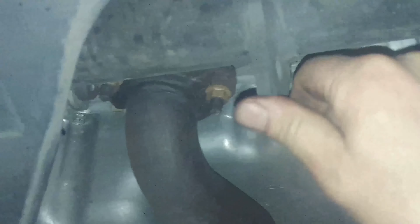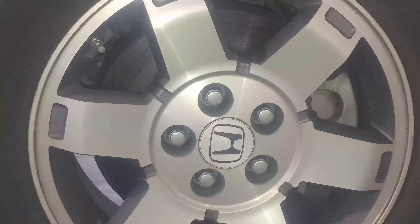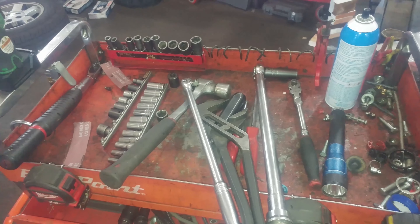Good places to jack down here — you want to center it on here. You can jack up and probably put both front tires up in the air at the same time. Otherwise, some good metal here. Jack up, use safety stands to protect yourself when jacking up your vehicle. Break the lug nuts loose a turn or two before you jack it up. These are 22 millimeter lug nuts — break them loose a turn or two, then jack up the vehicle and take the lug nuts off the rest of the way.